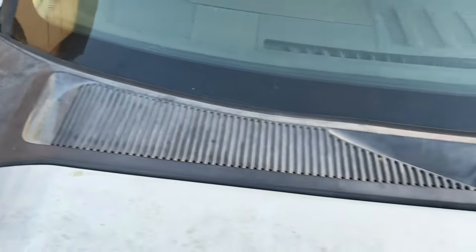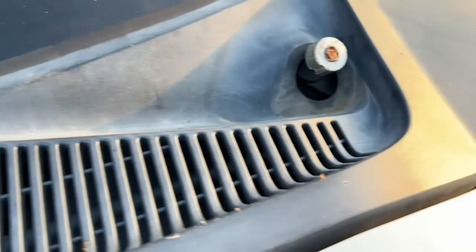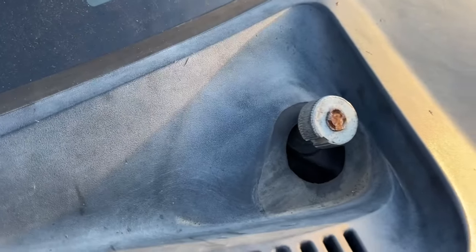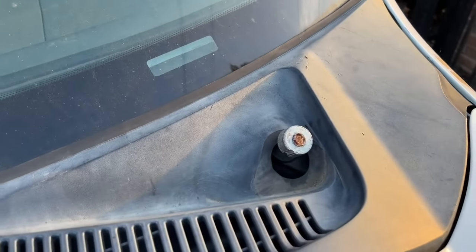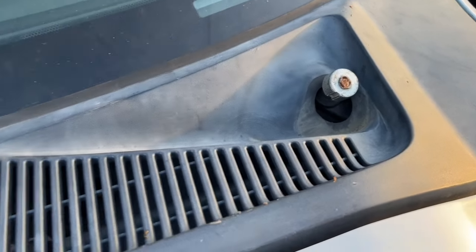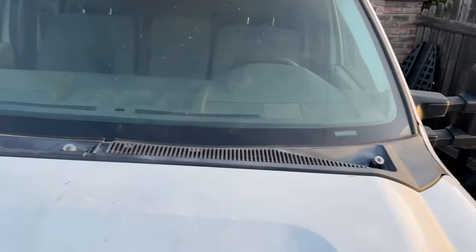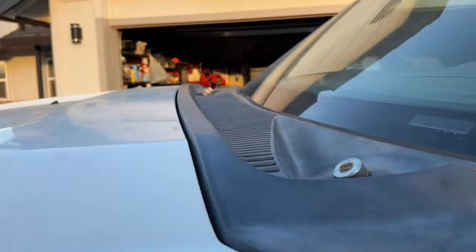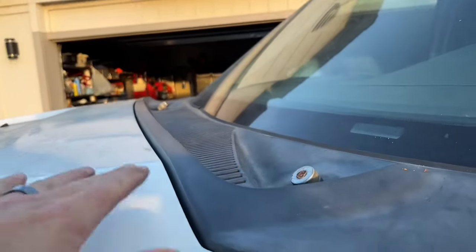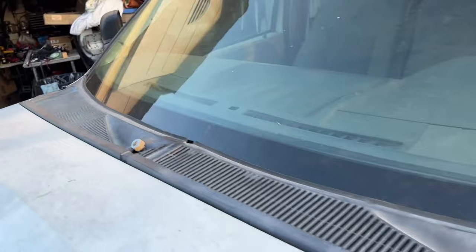The antenna is off-center just because the gear is different — this one's a little bit off-center. I trimmed that part right here in the back, the rubber piece. This one's a little bit off-center, obviously. That's why I lowered this side a little bit because it was going to be a little too high. I mean, if I was to do this again, I would completely lower it even more and go to the left a little bit so this can go down and to the left. I would completely redo it a little bit differently. But for what we got, it's pretty good. The gap is pretty good, it's pretty level. The gap's good here and here. The rubber is tucked in here. It's not super perfect, obviously, but I don't think it's going to get any better.